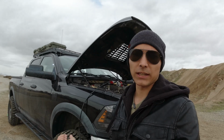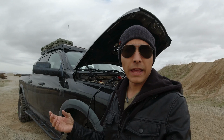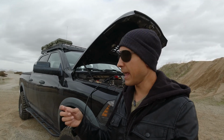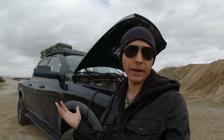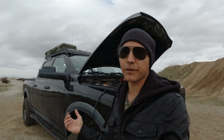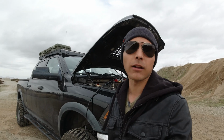And even if you leave the lines hooked up to the tires, because the airflow from the Schrader valves is so low, it really takes a long time for the pressures to equalize. And so, I mean, maybe if you sat there for like 30 minutes, they would all even out. But even sitting there for up to 5 minutes while I was grabbing food or whatever, the pressures were still off by quite a bit and they never equalized between all of the tires.